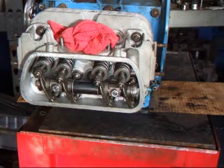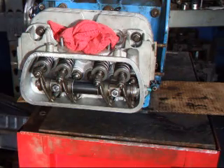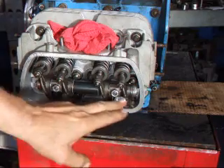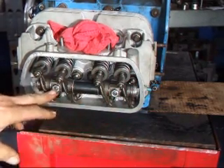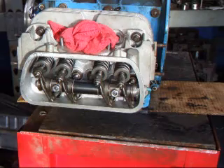Anyway, that's how you adjust the valves on an air-cooled VW. Fairly simple, fairly quick. You just have to make sure that you let your engine cool completely down before you do this. Another thing that would be recommended would be to remove the rocker arm assembly, tighten the bottom row of head bolts, put your rocker arm assembly back on, torque these down, and then do your valve adjustment. If you have any more questions about VW engine machine work, call John Edwards at Costa Mesa R&D. We'll see you soon.